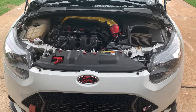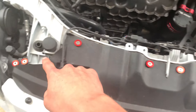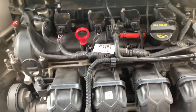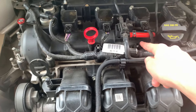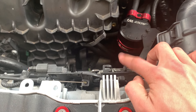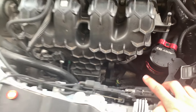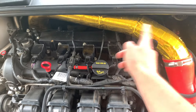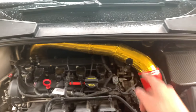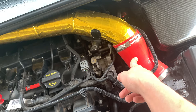There is some aesthetic stuff in the engine bay too — I painted this piece red with spray paint. I have dress-up bolts from eBay holding the headlights in and on some of the wiring harness parts. The dipstick is Plasti-Dipped red. I have this red piece of vacuum line because I lost the stock one — I used to have this routed to the true vacuum which goes to the sound symposer delete. The intake pipe is a custom welded three-inch pipe I got on Facebook, wrapped in DEI gold heat reflective tape to keep intake temps down.